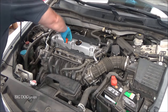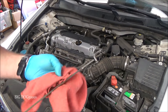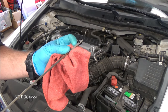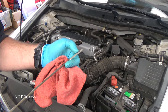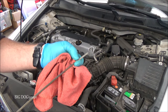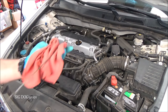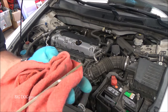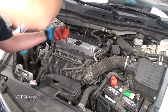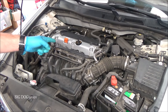It's been five minutes — let's check the oil level. Pull the dipstick out and wipe it off. On this one we have two dots — sometimes you'll see a grid mark or hash marks. There's a lower mark and an upper mark, typically one quart apart on most vehicles. We want it pretty close to the top dot. Push the dipstick all the way down and check — our oil level is right at that top dot. We're perfect on this vehicle. If yours is a little low, add a little bit until you reach that top dot. I prefer it all the way up to the top dot, and in this case, this vehicle is good to go.